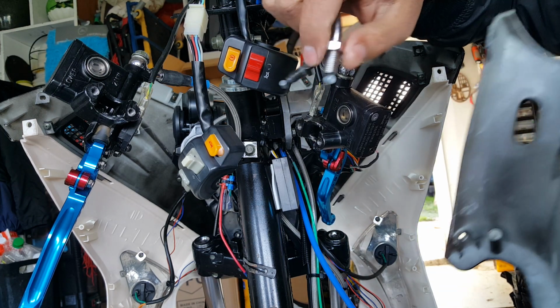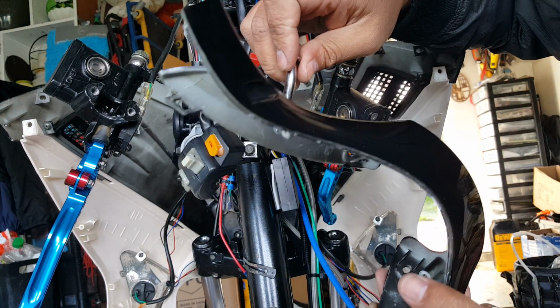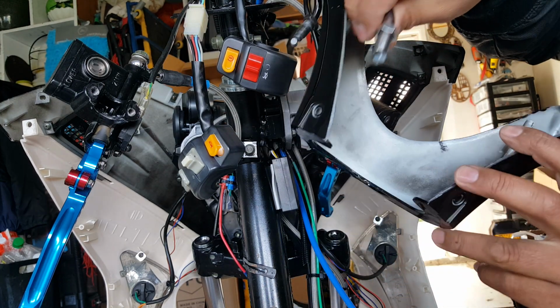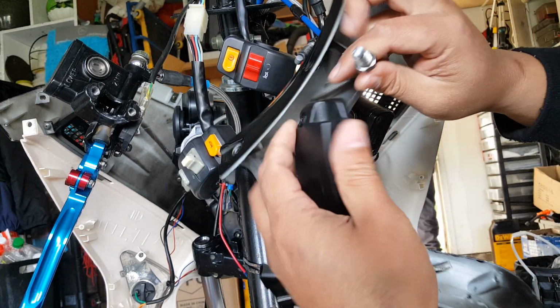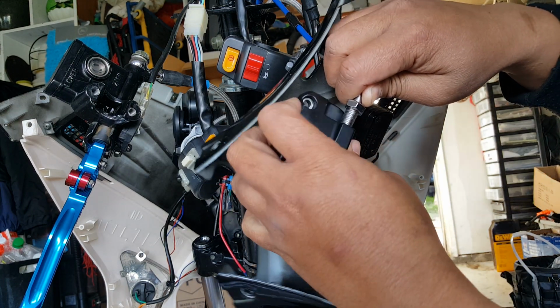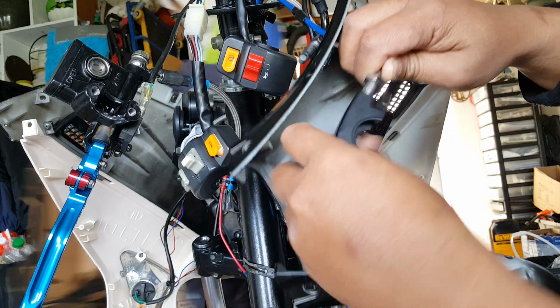Also, I was told that the cam chain tensioner, I probably need to put it in there even though it seems very loose. Because your engine does funny things once that, there it goes. See, now it's popped in. Okay, and then we can go and screw that onto here. So that's how you would take out your PWK or CVK and change, or just pretty much change out your throttle cable on the handlebar end.